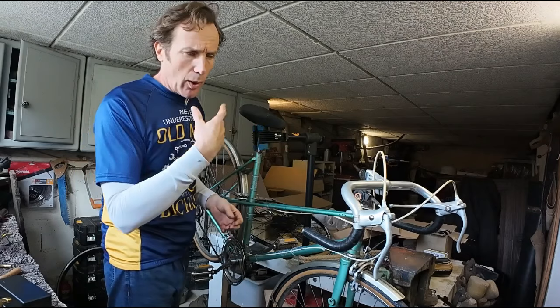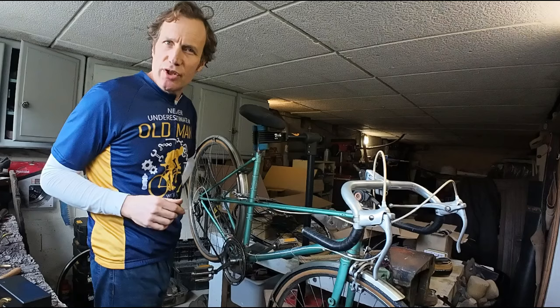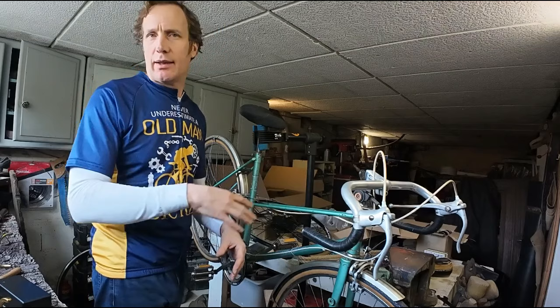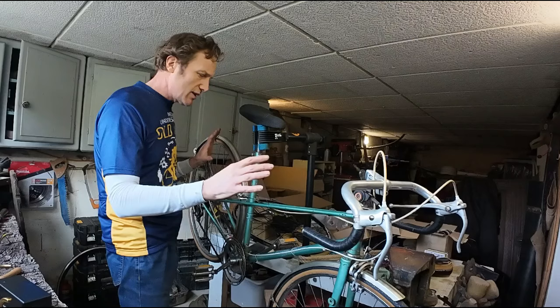It needs a really good going through. The bar tape is just electrical tape — not really up to scratch — and there are a few things that need to be changed. The saddle's horrible, and there are new lines and cables needed. Interestingly, it has Shimano's five-speed Positron — that's a great name — the Positron gear change system, one of the first indexing systems on five-speed. Before you think you can strap it to a Campagnolo five-speed, no — Shimano built it into the rear derailleur and did something specific up front as well, so you need the whole system. On this kind of setup it's absolutely perfect. I also quite like the Weinmann centrepull brakes — nice and vintage. This is going to clean up and tidy up really well.